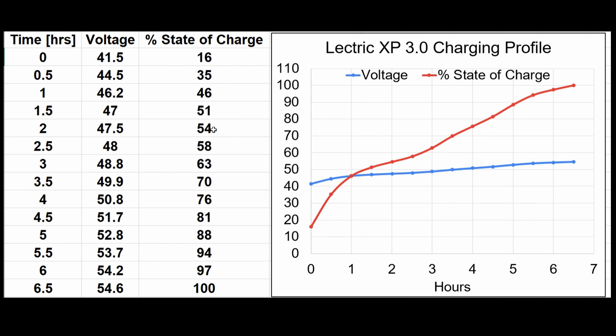This table gives you an idea of how to charge your battery if you're storing it for a while. You want to keep it near 50 percent — 50 to 70 percent is a good range. So if you start with a fully discharged battery, you'll want to plug it in for a couple of hours at least to get over 50 percent before storing it.